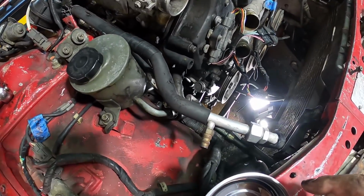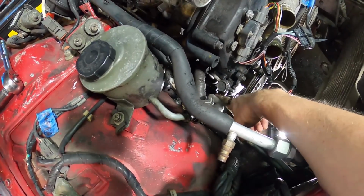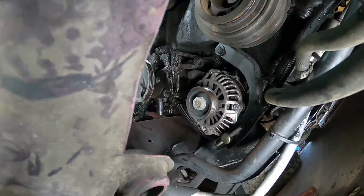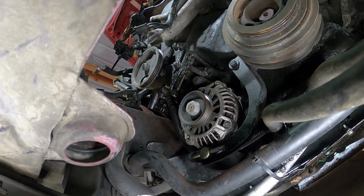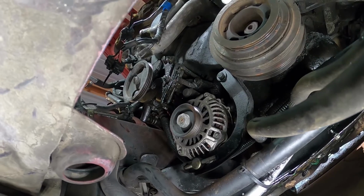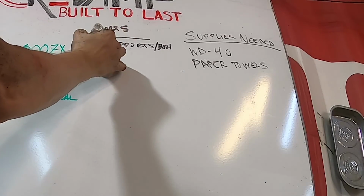All right, power steering pump right here in the way. Okay, so we got a lot of grime here. There's grime on our bracket. And you look underneath, there's grime all over. So I checked that hose. The hose seems tight. But since there's grime up underneath there like that, I'm pretty sure the front seal on that pump's bad. So we're gonna go ahead and replace that pump.